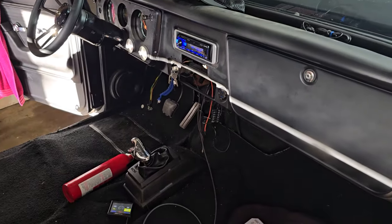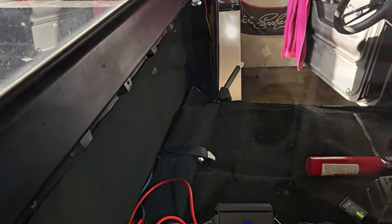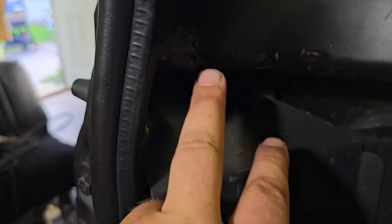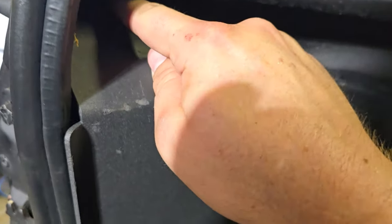I don't have the stereo on because I can't play music due to copyright. It jams really well — I'm really happy with this so far. We're going to go ahead and get the 6x9s installed. I got the 6x9 frames in here — I actually had to pound these with a hammer so it's a bit roughed up in shape, but I got these off eBay, I can link them in the description. I put the frame in first and this tab touches the metal right here, so I just hammered it in. It's completely wedged in there and won't move. I might throw a weld in there or bolt it down into the frame.